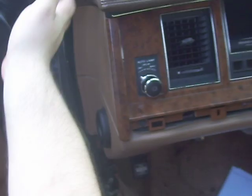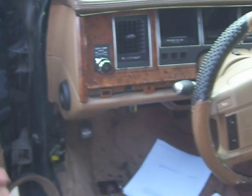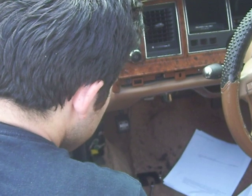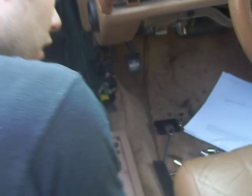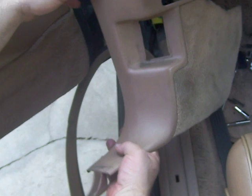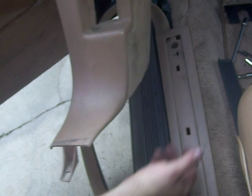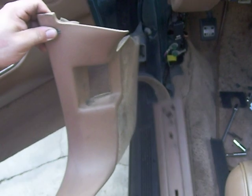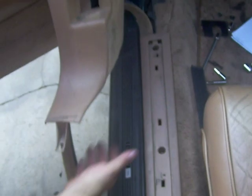Three screws — pull it up. Then along the door here, there is this trim right here. Very simple — you can just pull it all off, there's nothing bolting it in. But in order to get that off, you have to unscrew this first screw, which also holds in this kind here on the bottom. So once you pull that off, you can pull the whole thing off once that screw is out. Two screws. The floor trim piece — once the first screw is out, you can go ahead and pull this off, but you're going to need room to pull it up to get it off because it fits in a little slot.